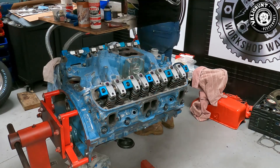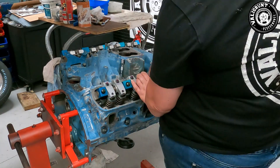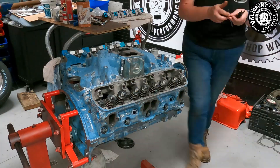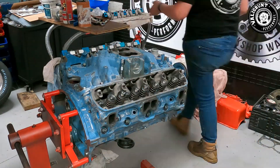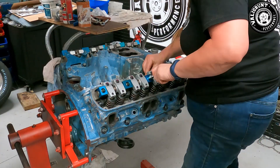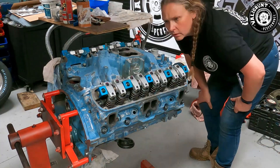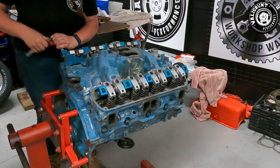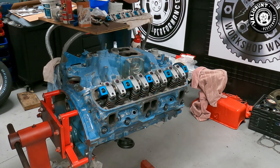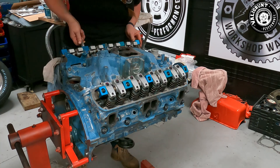We left the intake because raising intake efficiency wouldn't make a difference — it would have been about 595 thou on intake, and if we had 595 on intake it wouldn't have made a difference. All it would have done is put extra pressure on the valve train, and I'm not interested in doing that — I'd rather make more power. At least this way it improves scavenging by having 600 lift in the exhaust. These J-heads — even though these heads are extremely ported — are really a bad design head and they have a lot of dead spots for flow. But we've done the best we can, and anything we can do to help these heads flow, we're doing.